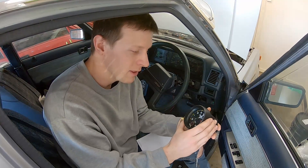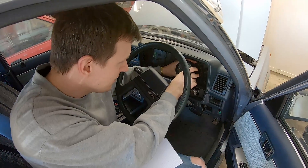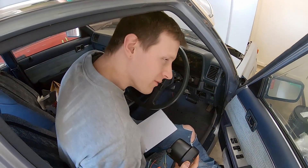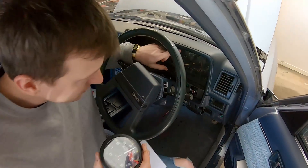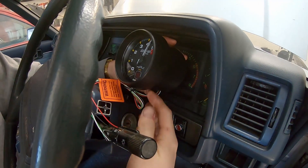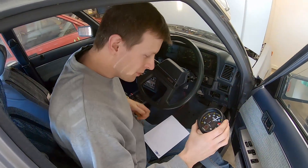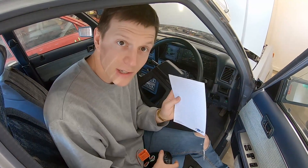What you're going to want to do with your gauge is pick a spot in the car. I'm going to put it in front of the original tachometer because this one doesn't work - if you've done an engine conversion you might run into that problem. I don't want to cut the dash, so I'm going to use this bolt hole and this screw hole here and 3D print something to hold it there. The wiring will just tuck around here and then disappear. Don't be afraid to use pen and paper - you don't have to go all digital straight away. Sketching is a good thing to do.